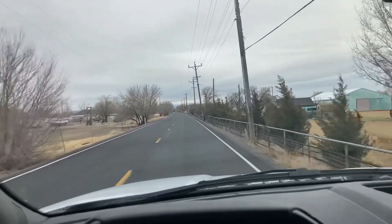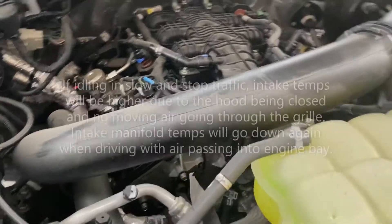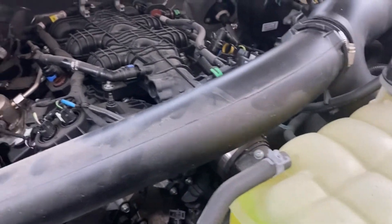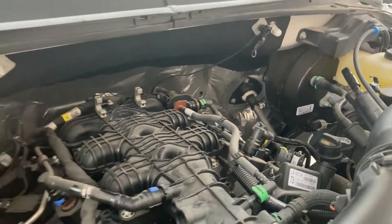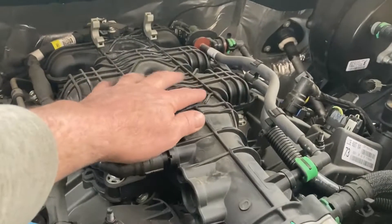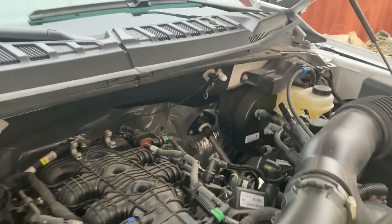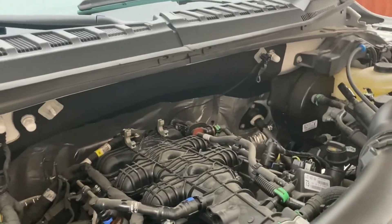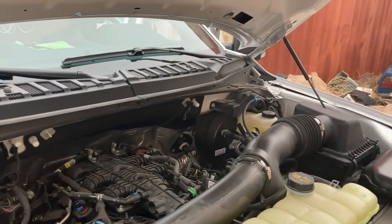So far I've just done the hood heat shield and the engine cover, and removing those has netted me a few degrees colder. I just finished a 40-minute drive, and the engine at the intake manifold is cool to the touch. Even though everything else below is hot — the turbos are hot, the exhaust manifolds are hot, the heads are hot — the intake manifold is still cool to the touch. Even after a 45-minute drive, the intake temperature at the manifold never got hotter than 90 degrees.